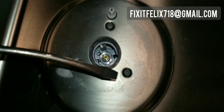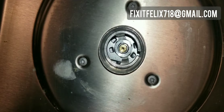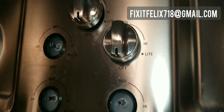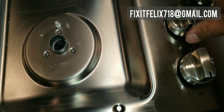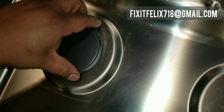Make sure nothing's inside that little orifice — sometimes there's a wire, or maybe you drop something in there. You don't want that to happen because the gas won't make it to the top and it spreads around. Now we put the knobs in place. These knobs — the arrow points to the off position, or there's a little D-shape that you have to line up and push it down. It's pretty easy to push it straight on as long as it's in the off position. The burner heads have a little notch in them — you want to line up that notch with the sparker and make sure everything's nice and flat.